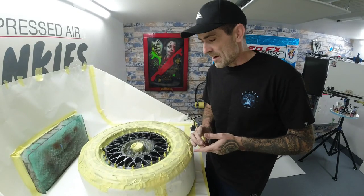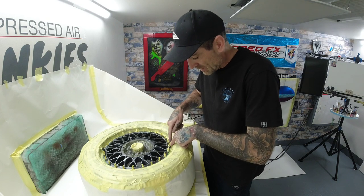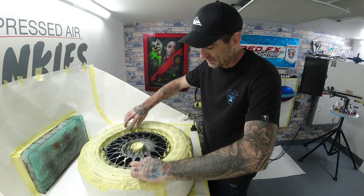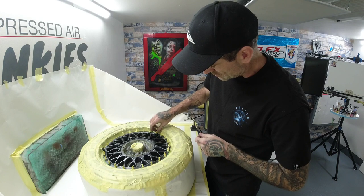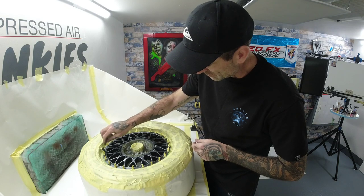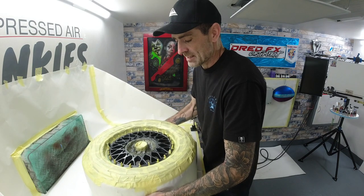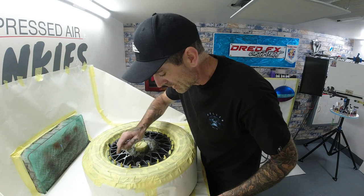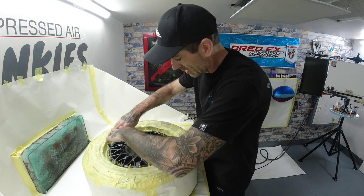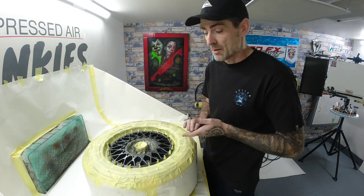I'll talk you through that painstaking masking piece. I first went in with a piece of fine line on the internal part of the rim, went all the way round, then masked off the fine line coming up the lip of the rim, masked that piece out, and then covered up as much of each bolt head all the way round as I could. The next stage will be to give it a little blow down, tack rag off, and then move on to the FK50 surface binder — give it a nice wet coat all in here and on this piece — and then we can get onto the metal flake.